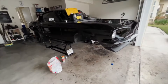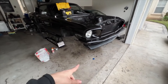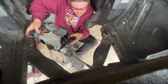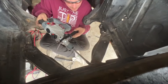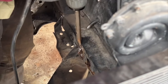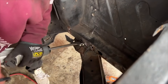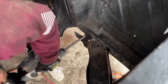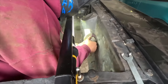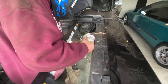Now she's looking pretty good. With the car stripped down to the shell, we need to cut the car in half. Coyotes don't belong in these cars obviously — the dual overhead cam makes the motor huge, and the engine bay of the 1960s Mustangs is small. The strut towers are what's stopping the engine from dropping right in, so I have to cut the car. Not only did I not know how to do a Coyote swap on a classic Mustang, I also don't know how to weld and fabricate. So I needed to find a welder and fabricator — that's where my buddy Bryce came into play.